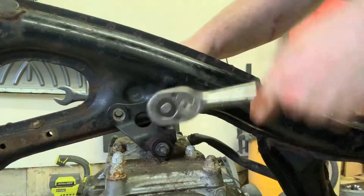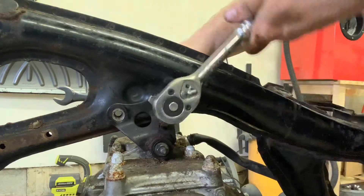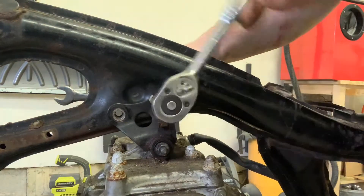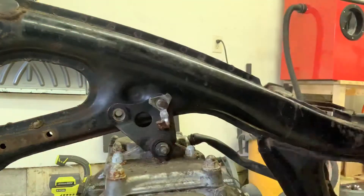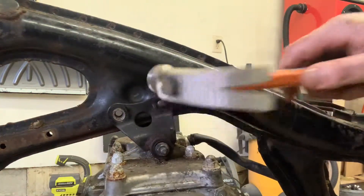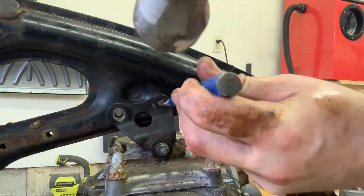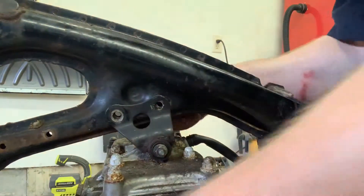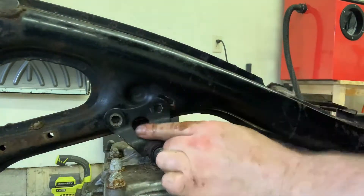Notice there's a couple of little wire stays that are there — we'll save all that and pull out this top bracket. Got it. We've got our nut, we've got the wire stay that acts kind of as the washer. I'm going to have to tap on this one to get it to come out of there, probably have to grab my punch as well. There we go — see that engine shift? Engine's getting ready to come on out. Give it a little pull. This engine is pretty much independent — the only thing holding it in is this bracket right now.